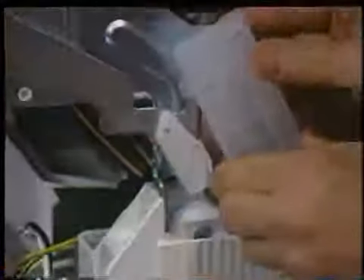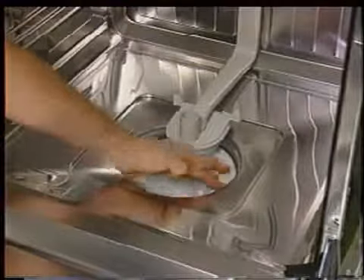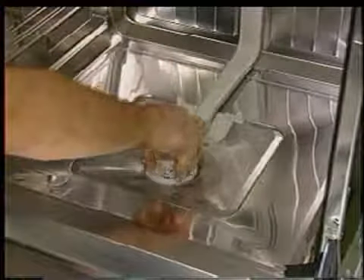Now remove the block and insert the base back onto the tank and reattach the pulley arm to the hinge. Then bring the dishwasher back to an upright position. Before installing the base mounting screws, check inside the dishwasher to make sure the sump gasket is in place and properly seated. Then replace the two sump clamps, feeder tube, filters, and spray arm.